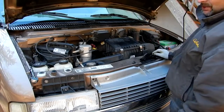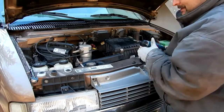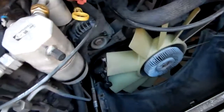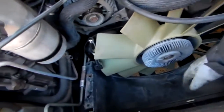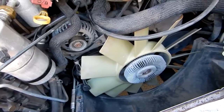It's just one thing after another — it never stops. That's part of owning a GM vehicle; you're always going to be working on it. So I took the belt off and checked the water pump — it's zero play, solid. When you spin it, it's nice and silent, so it's definitely just a seal going bad.